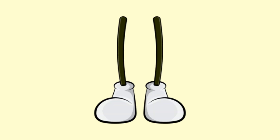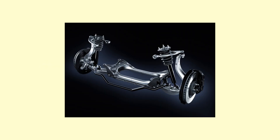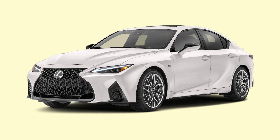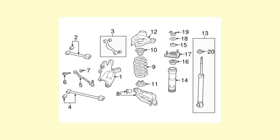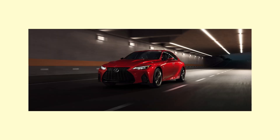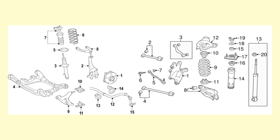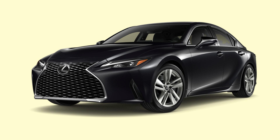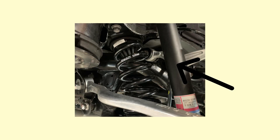Let's now move onto the suspension. Just like the ISF, double wishbone front and multi-link rear suspension have been used, along with a new Yamaha-tuned rear performance damper specifically for the IS500. This damper reduces chassis flex when driving, giving better comfort at low speeds and extra stability and agility at high speeds. The suspension received 20% lighter coil springs, 18% lighter aluminum control arms, and new anti-roll bars, reducing weight by 17% compared to the IS350 F-Sport's suspension setup. Lexus used gas-pressurized swing-valve shock absorbers which add a second valve tuned specifically for small movements, allowing engineers to tune the primary valves for big suspension moments while using the secondary valves to maintain ride control over small road imperfections.